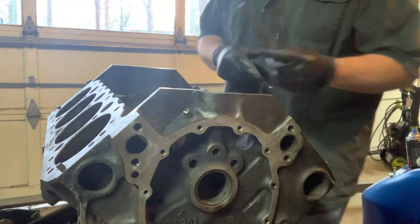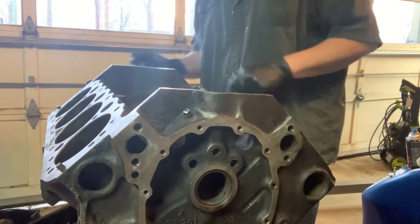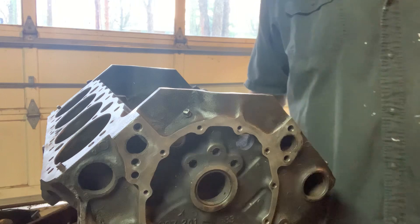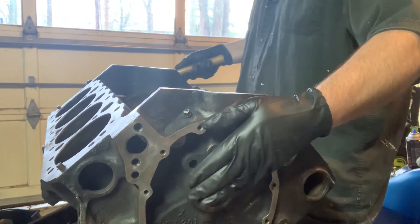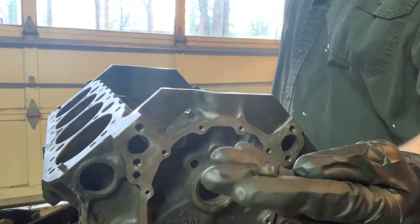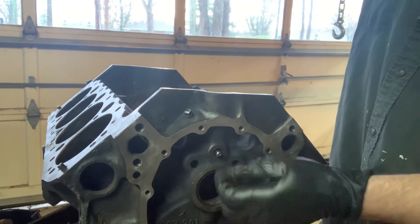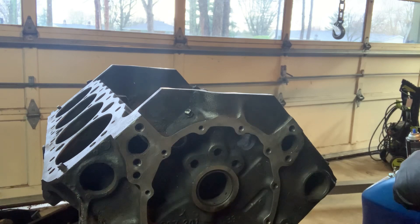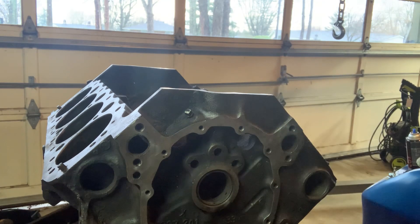So again, if you've got three push rods or something similar, you just run these down the oil gallery. I can feel resistance in there already, which tells me there's a lot of junk and oil sludge built up in there. All you're doing is putting those in there and tapping until that little plug comes out — that's all you're after. Once you get the plug out, that frees up these holes so you can clean them up. When you wash your block, make sure you're running brushes in there. Then we'll tap it so we can go back with a threaded nut instead of these little plugs.